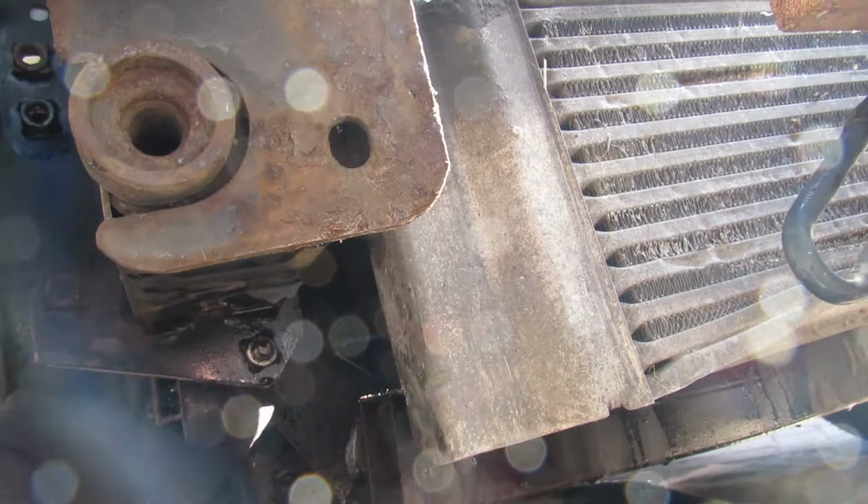We're refitting the water pump. I'll just show you the torque settings. So for the smaller bolts, it's 14 newton meters, and for the slightly bigger ones, it's 20 newton meters, from the sources I've managed to get it from. The other thing I'd mention is, we're putting the big bolts in first. The big bolt here on the left is slightly longer than the rest of them. If you just put a smaller one in there, it won't quite bite. If you think that thread's gone, it hasn't. You just haven't got the right bolt. There's a really long one that goes on there, about 10 mil more. It does make a difference. So that goes in there.